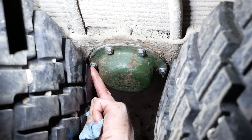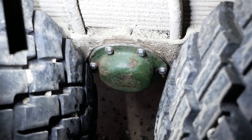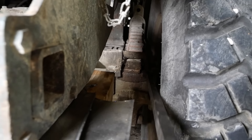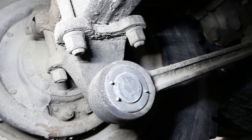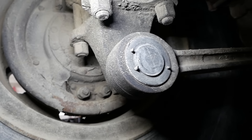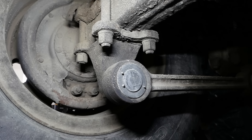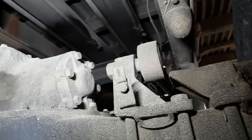Hopefully you guys can see just how close this tire is — it's one finger width away from that bolt right now and there's actually more room for the whole axle to move over before the spring would hit the side of the spring pad. We did fix the spring side-to-side movement so I guess that's an improvement, but I just don't think it's going to solve the problem of the dog tracking and the tires rubbing. These tires are just too big. So the only other component of the suspension that could really be worn is these dog bone bushings. There are 12 of them and they look pretty good to me. I just really don't think there's a problem there and you could spend a fortune replacing all those things — at a minimum an hour a piece times 12 plus parts. So yeah that could get pretty pricey.